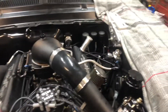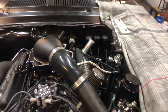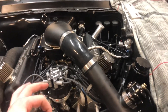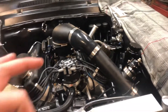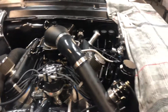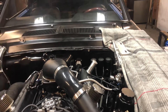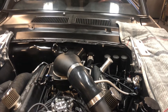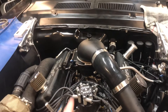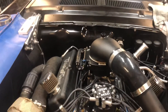I know for a fact I had torqued that bolt to 40 foot-pounds with blue Loctite when I assembled it. The washer that was on it didn't look factory. We went and picked up a new Grade 8 flange bolt and a different washer that fit tighter with a larger diameter, so it covered over that dowel pin better. Also, the dowel pin in my cam was undersized — pre-73 was one length, post-73 was another. We took a 5/16 Grade 8 bolt, cut it to size, and it was an exact machine fit, so we put it in its place.